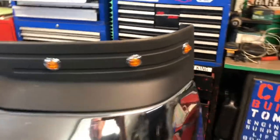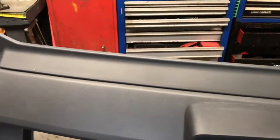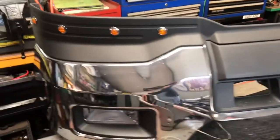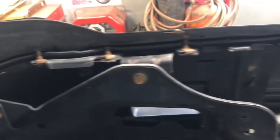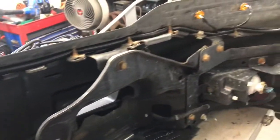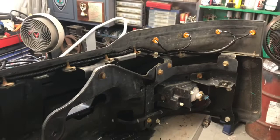I just did one side — didn't do any across the front because it's on a weird angle, but you'll be able to see it anyway. I soldered all the wires, taped them up, put them in wire loom, and ran them all the way underneath behind those bolts. Same on the other side. Then I ran the power feed through here to the marker lights in the headlights, so when you turn on your parking lights or headlights they will come on — that's tomorrow.